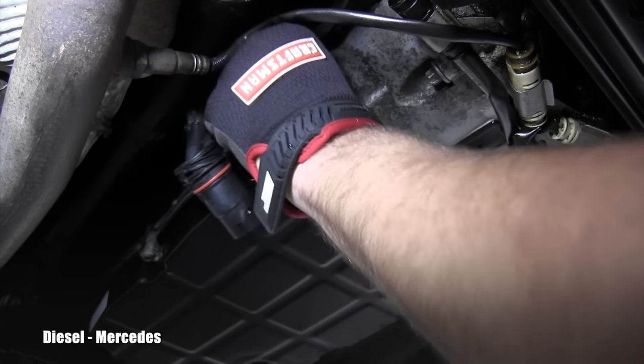Normally there is a steel heat shield here with its Torx 30 bolt, but I'm not putting it back right now because I want to make sure I don't have any leaks and it would be in my way. Moving up to work under the hood — I will be filling the transmission through the dipstick tube using the correct Mercedes-Benz fluid. Here are the part numbers if you want to order the same. These 722.6 transmissions are extremely sensitive to the correct fluid — you can use this one, or you can Google Mercedes-Benz sheet 236.14 which gives you a list of approved alternative fluids.